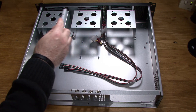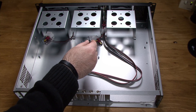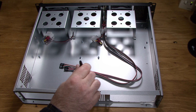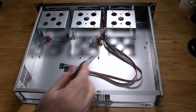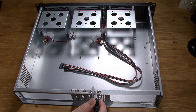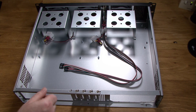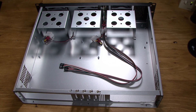There are three drive cages — these hold one 3.5-inch drive each, and one is able to hold two. You see standard Molex cables for the fans and cabling for the front case controls. There are low-profile slots here for PCI cards. Your motherboard will go here; the power supply will go here. The expansion card brackets are actual solid pieces — not breakaways — so that's a nice touch. The edges are all well machined. The only sharp edge I found was this back edge, but the other areas are nicely rounded over. It doesn't feel like cheap construction, and it comes with standoffs pre-installed.